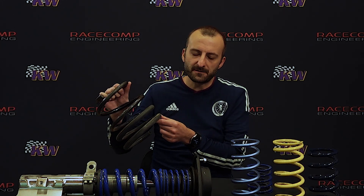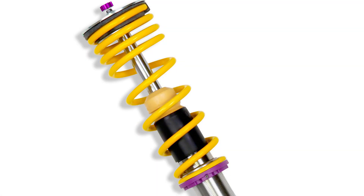That different winding spacing means the factory spring is a little bit progressive, as opposed to these standardized springs which are linear. Some coilover springs are progressive. One advantage of a linear spring is you do get a little bit more tire clearance, which can be important on cars like a Subaru BRZ or WRX where the strut can impact the tire. Thanks for watching — this has been Andrew with the Apex Files, be sure to like and subscribe for more tech tips.